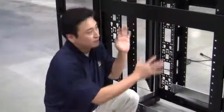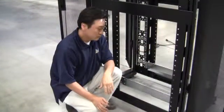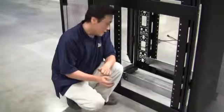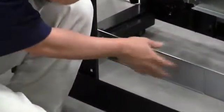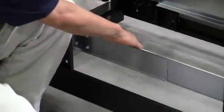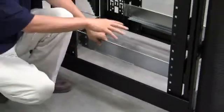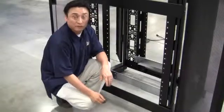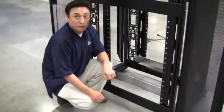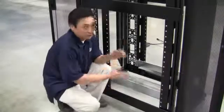In this scenario, the rack's side skins have been removed, which gives us access to the screws. If your rack has a side wall that is not removable, the job is a little more difficult. You'll need to attach both the front and back ends, put the assembly in without tightening the screws to measure where the screws should go, then remove it, tighten it down, and try to put it back in the rack. There will likely be some give and play, and it may take a couple of tries. Unfortunately, there isn't any other way to reach these side screws if you can't remove the side wall.